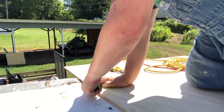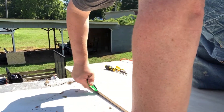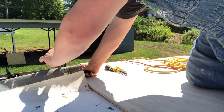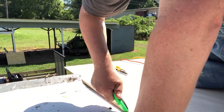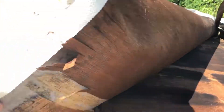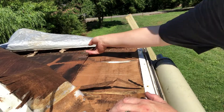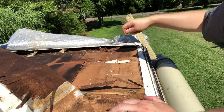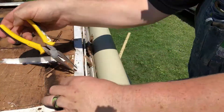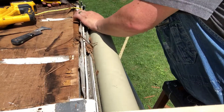I started by cutting the roof — this isn't something I recommend, but this was in the very corner and I couldn't get the flap up without either cutting it or going around the other side. So I took a chance cutting it, and I don't think it's anything that Eternabond can't handle. Once we have that out of the way, we roll that flap up and look at all this delamination on the plywood — it just peels off. I did take a scraper and get some of it, but most peeled off by hand because it was so soft. Then there was some flashing that overlapped the plywood, so I had to cut it with the reciprocating saw and bend it up to clean that up and get the new piece in.